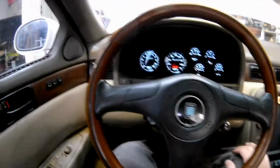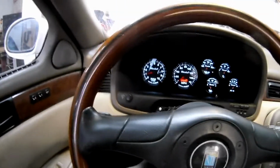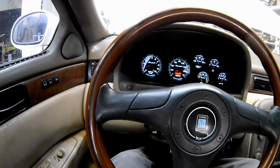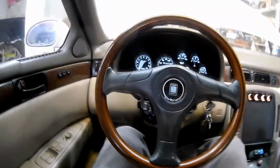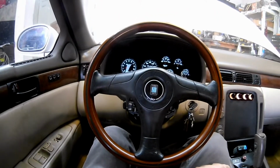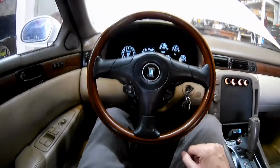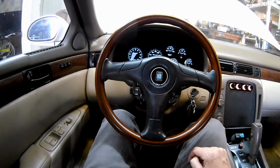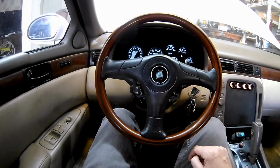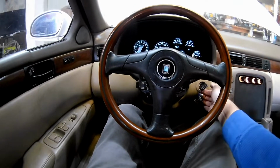But yeah, it sits here like a real car. The odometer is accurate. I used HP Tuners and an adjustment. You can actually tune that one, the pulses per mile. It's super easy to check speedometers nowadays with an app on your phone that uses GPS, so the speedometer is dead on, which is nice. And yeah.